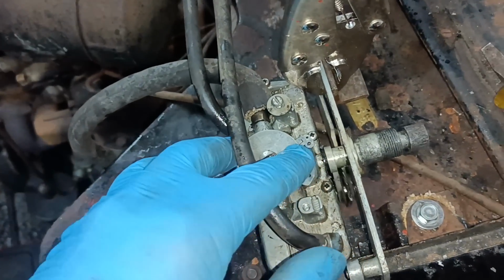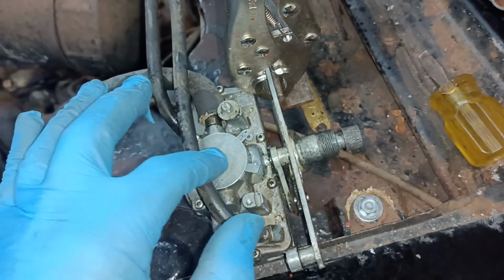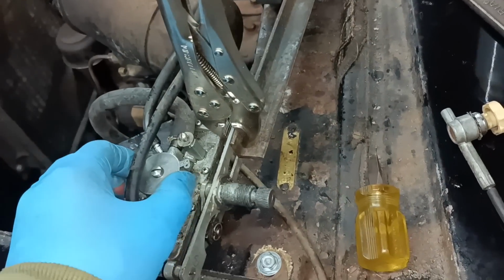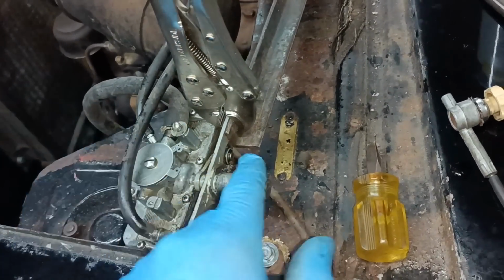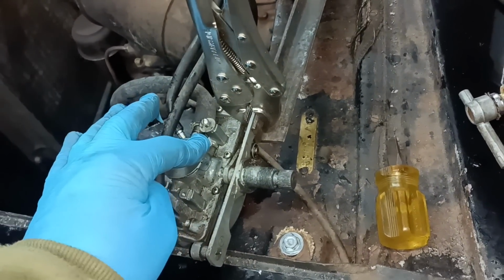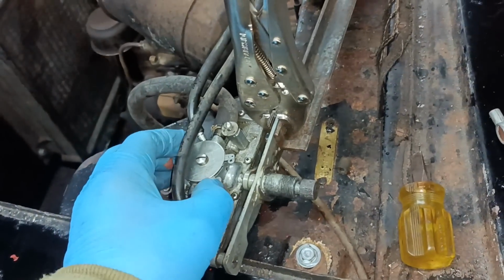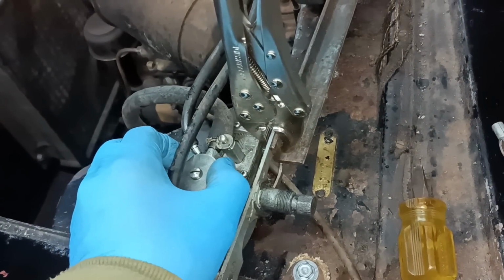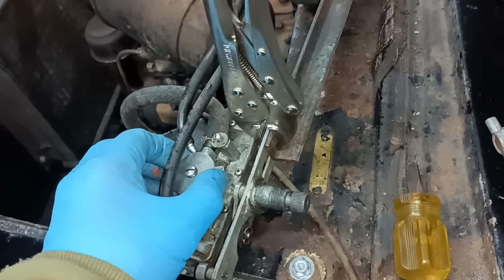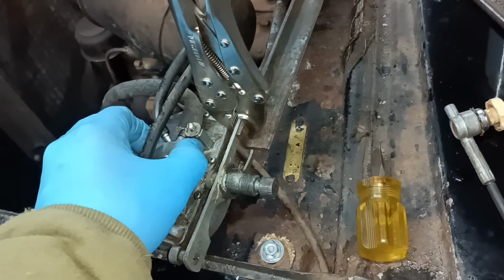On there is a letter L. If you take this thing off and turn it over, the wipers work in the other direction, and they park on the opposite side. They park over here. If you turn this piece upside down, they're full blast open there, and when it comes here, there it parks on the other side. So that's run, and that's park.